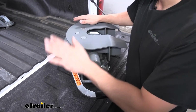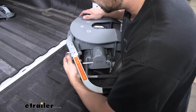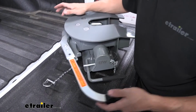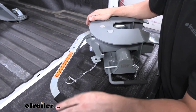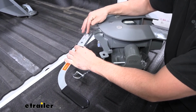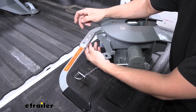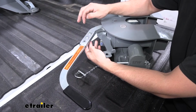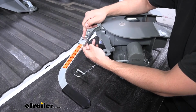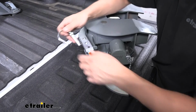We're going to go ahead and install our latching handle. In order to install this, as you can see, we already have it installed, but it's super simple to do. We'll simply undo the clip here, and we're going to pivot it outward. Then we can take our handle, we can slide it into the groove here of this casting. There's going to be 3 holes. We're going to be using the rear 2, and they're going to come with an Allen head screw and a nut that will be used to secure the 2. We're going to need a 7/32 inch Allen key and a 14mm wrench in order to tighten those both up. But that's pretty much it. We can go ahead and lock the handle back into position.